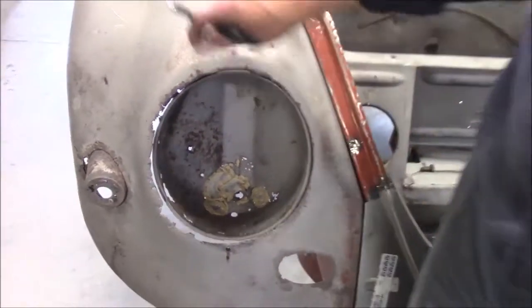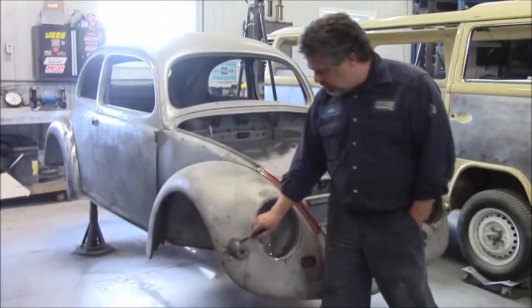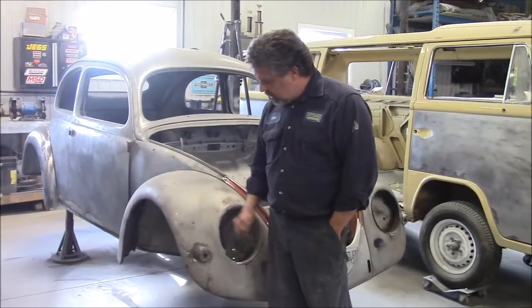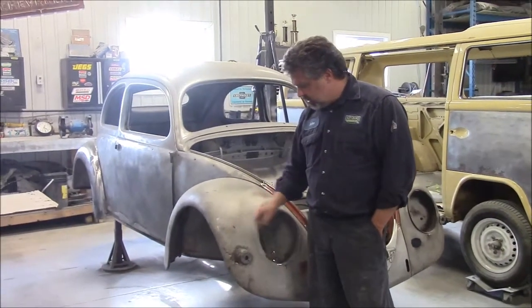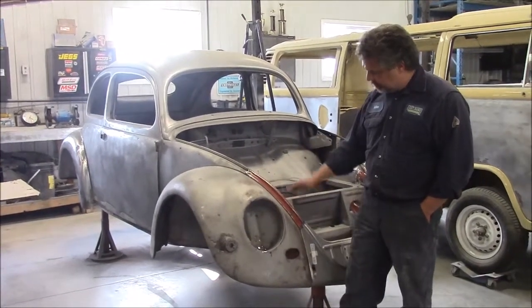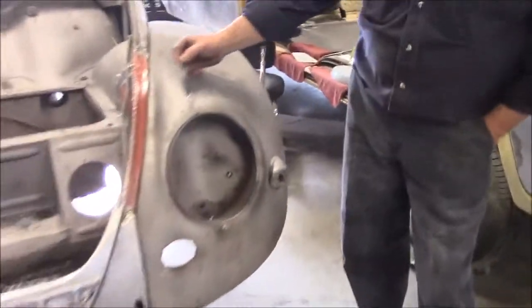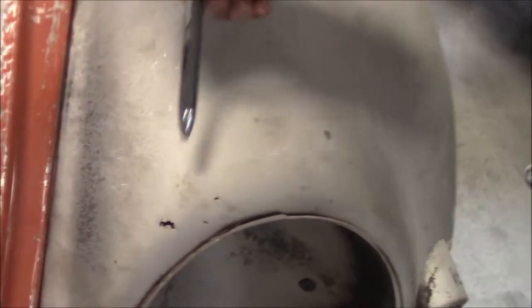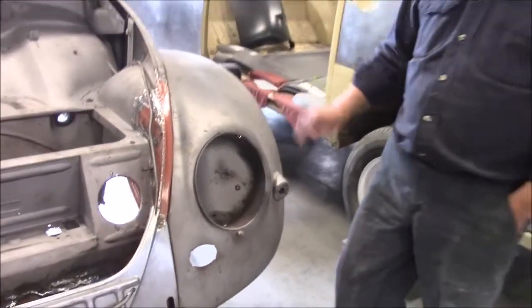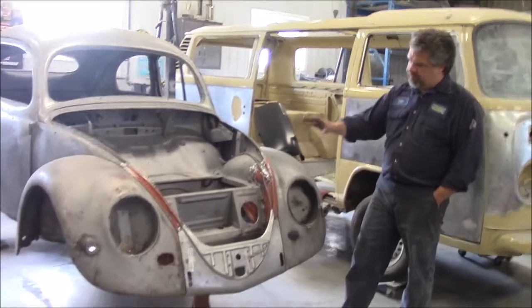We may consider replacing these front fenders. We're going to see if we can find a nice supplier — they never have these pockets for the marker lights, but we know of a supplier that provides these. I think one of the options we're going to look at is replacing these fenders; they're pretty far gone. You can see on this side we've got quite a bit of corrosion and rot, with lots of pinholes that are rotted through. As we strip and sand this down, it's probably going to expose some more weak points in the metal. We'll discuss it with our client to see which he would rather go with when it comes to the front fenders.